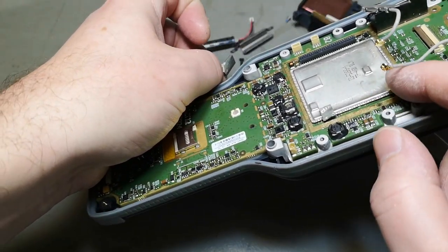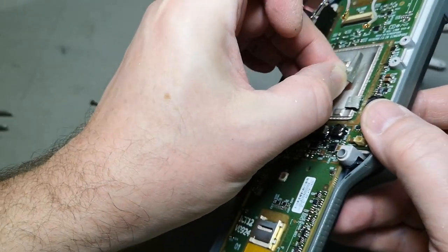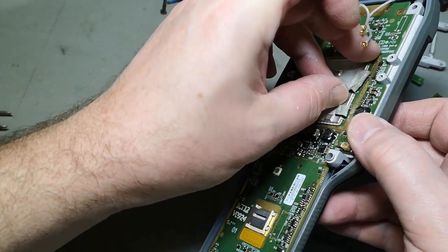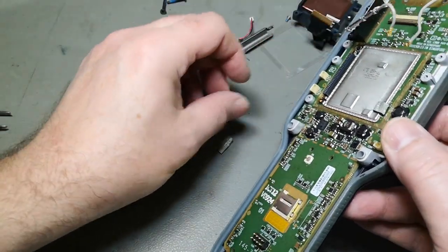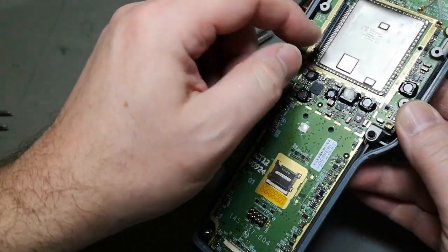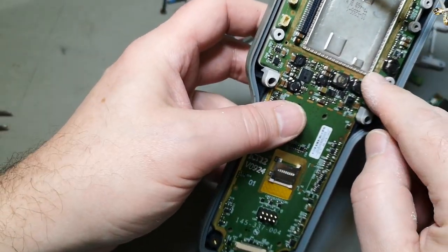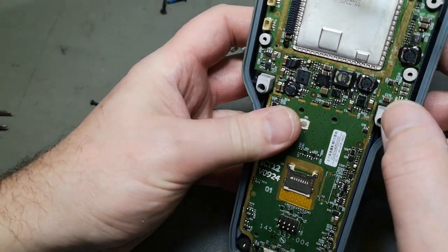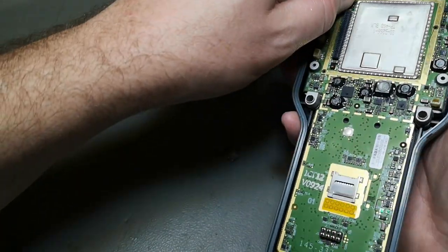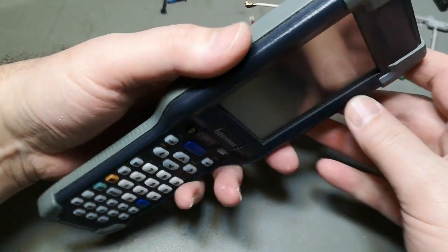So down here we got the CPU modules. We can even see some of the chips there, see? I don't know if this is easy to see, but on this kind of shield metal, we still see a little bit of acid leaks. Remember that big capacitor was located here, so it did drip a little bit down here in this area. So that can of course confuse electronics, because this kind of drip drip kind of stuff is definitely conductive.